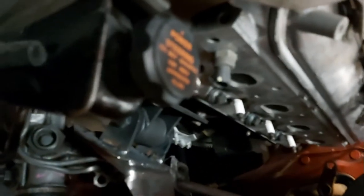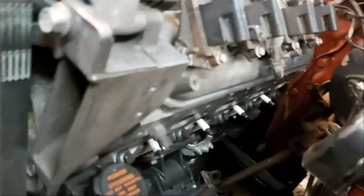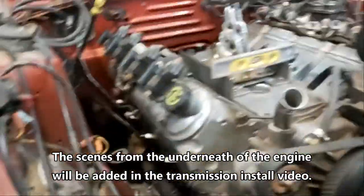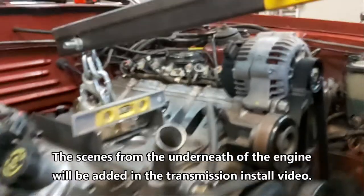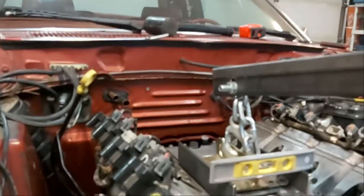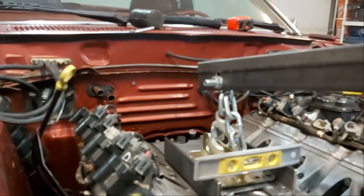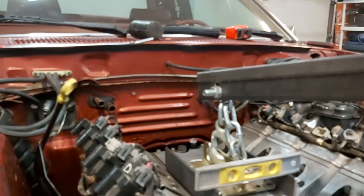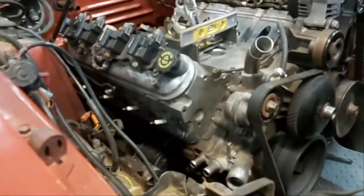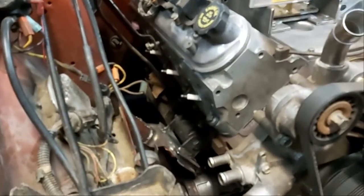Here's the factory booster on the Fox body — lots of room there for the manifold turned upside down and the power steering pump. The Mustang rack is right there, and the oil pan clears nicely. I'll add another scene showing the bottom view once the mounts are fully welded. The alternator should clear — I put a straight edge across and the center of the hood is higher than it looks. With the truck intake being pretty tall, we've got about 13 to 14 inches before it hits the cowl area, and we need about 12 to 13 inches to clear everything, so we're in pretty good position.